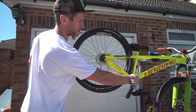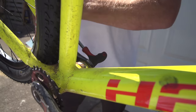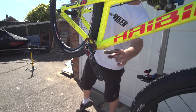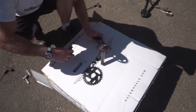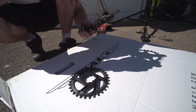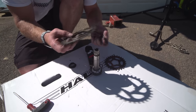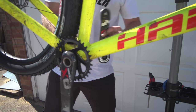So let's take the crank off, switch the chain ring and then get the gears on. We've got to take the whole crank off to change the chain ring - bit of a faff but needs to be done. I'm going to go for a 32 tooth as opposed to this 27. Hopefully that will be enough. Switching to this X-sync chain ring, which sounds impressive. Nice - cranks on.